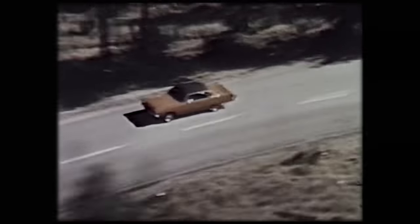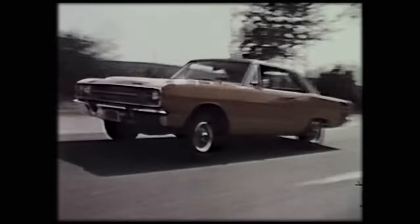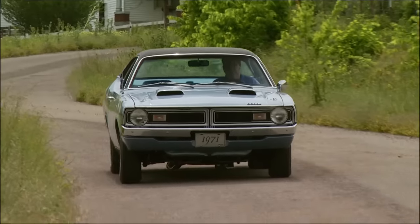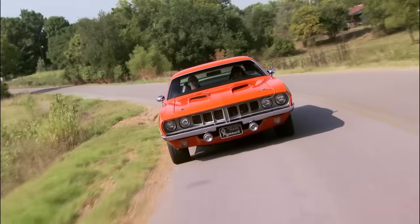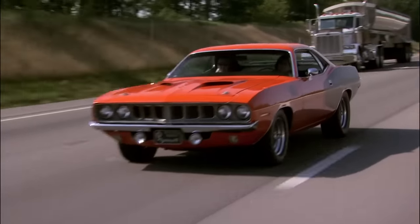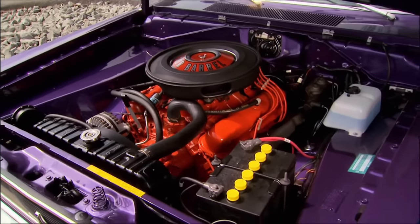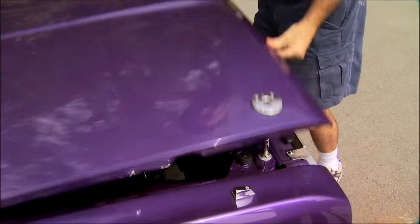The 318 was one of four LA series engines that powered factory Mopars starting in the mid-'60s. A lighter version of the A engine — hence the name LA — they were efficient, durable, and fairly powerful small blocks found in A, B, and C body Dodges and Plymouths. The superstar of the family was the 340, with high-flow heads, big ports, and a six-barrel option — reasons they often called it the Hemi of the small blocks.